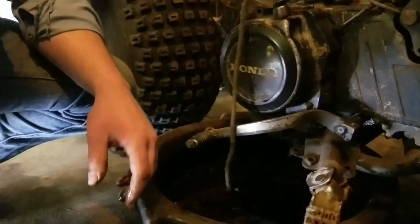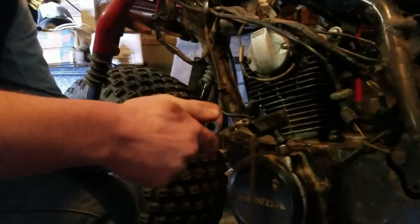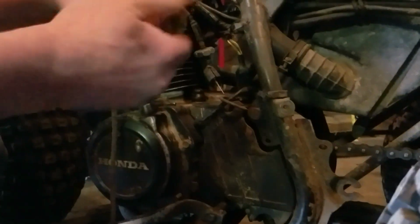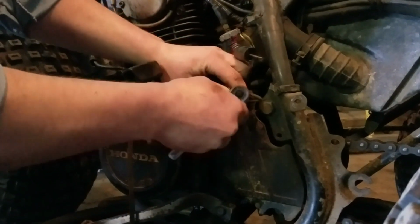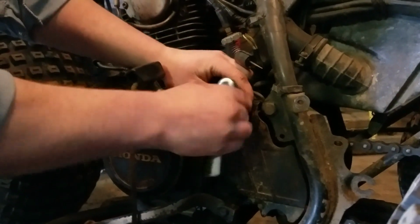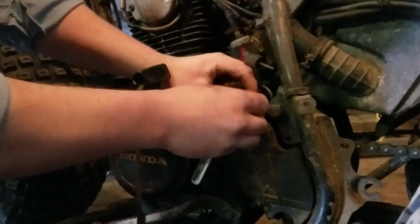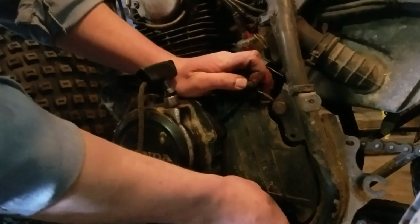But as that drains, we're going to go over here, get our 1/4-inch ratchet from our fancy stockpile, and an 8mm socket. Deep well or not, maybe extensions would work, but we have a deep well, so that's what we're going to use. Once you break them all loose, and your hands aren't oily like mine, you can get all the bolts out. This is the cover for the front sprocket. This is what actually drives the chain, that drives the axle, that makes your face smile.